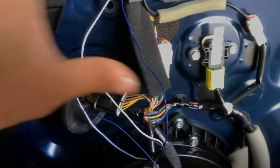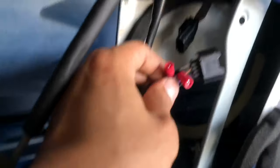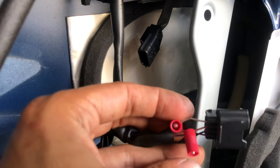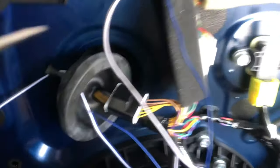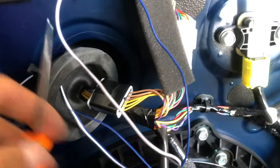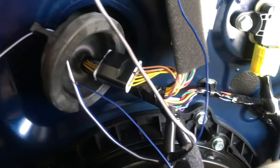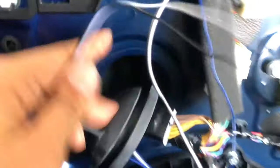After everything is connected, I removed the black plate to expose this harness here. Tap into the gray wire being ground, and then tap into the brown being positive. Pull this grommet off, make a small micro puncture with the screwdriver, tie the wire to the end of the tip, and push it through. Then using that tape method, fish the other line right through and pull it. Now put this into the hole and wrap it around.